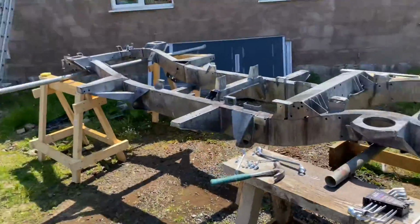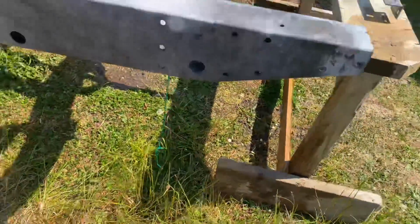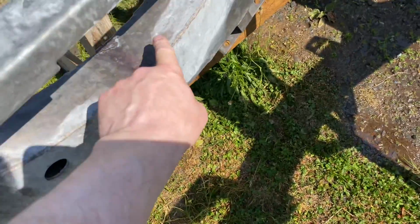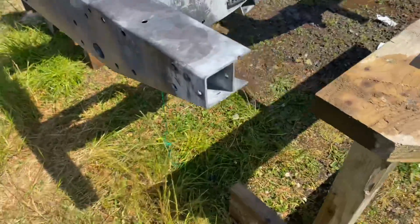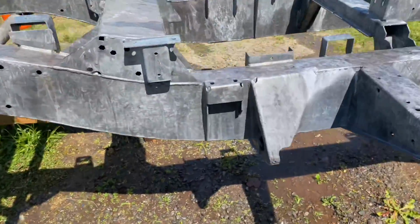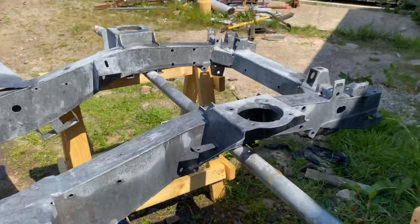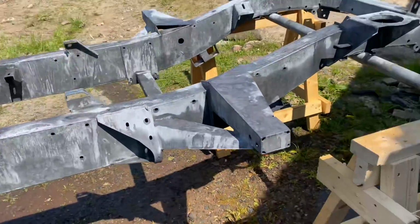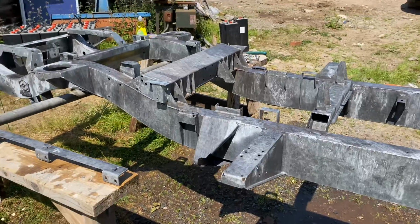So we've just washed the T-wash solution off. You see where it's quite smooth, it's not etched the same as where it's sat in the chassis, it's kind of giving it a better etch. I believe after acid etching you're supposed to prime them within 48 hours, so we're going to have to wait for this to dry and get some primer on it fairly quickly.